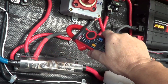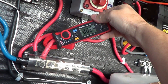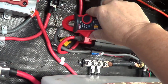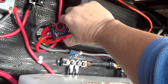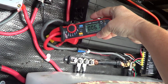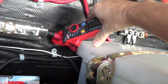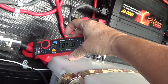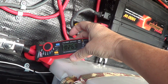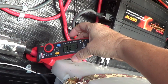I can also check the amperage that my RV circuits are drawing — we've got about 2.4 amps. And I can quickly check my inverter to see what it's drawing — it's around six or seven amps. Coming here to my main battery cable, you can see I'm feeding charge amperage of about 22 to 23 amps going up. There are hands on the computer so it's fluctuating right now.